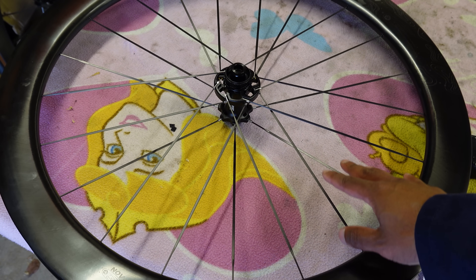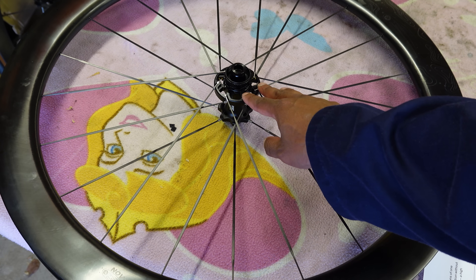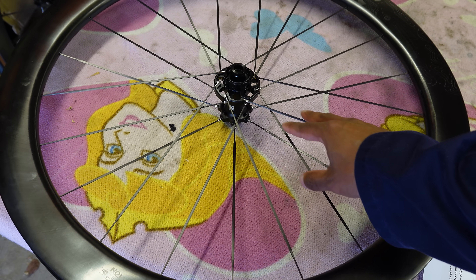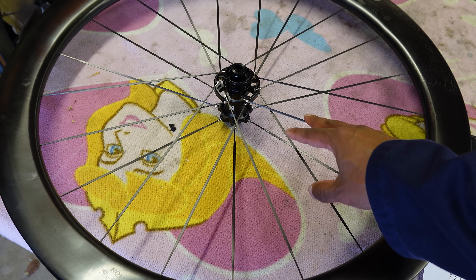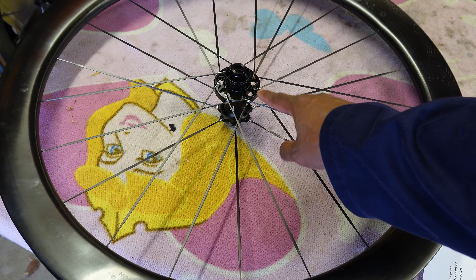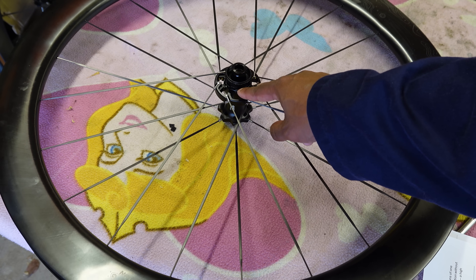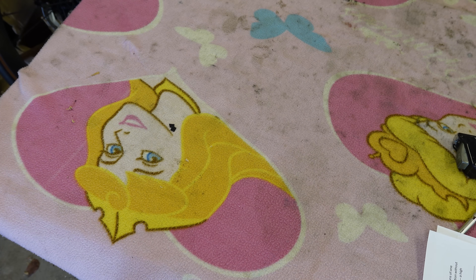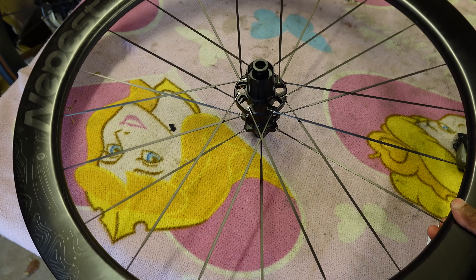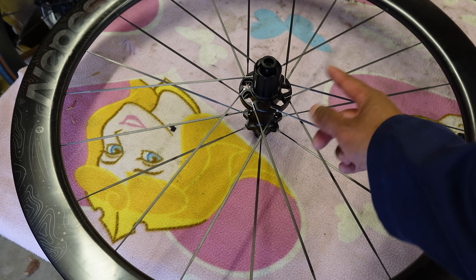The Nova is cross-laced on the corresponding drive side. For the front wheel, the braking force goes through the disc brake side, so the non-drive side is cross-laced and the drive side is radially laced. Cross-lacing is necessary because accelerating loads cannot be transmitted through a radially spoked wheel — you need that on at least one side, and it's most advantageous on the side nearest the braking. On the back wheel, the drive is on the same side as the cross-lacing, which is the opposite of the front and gives you better stiffness.